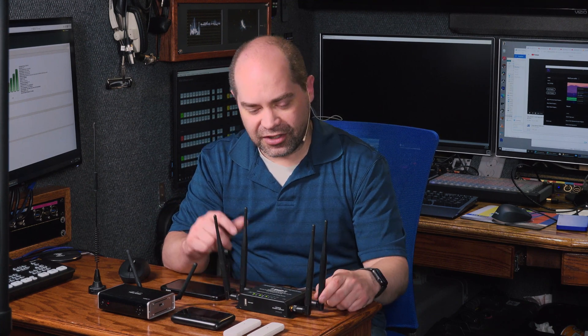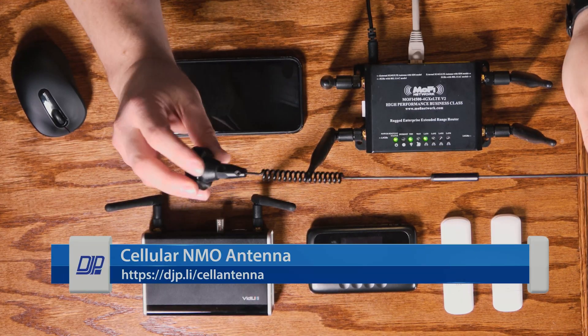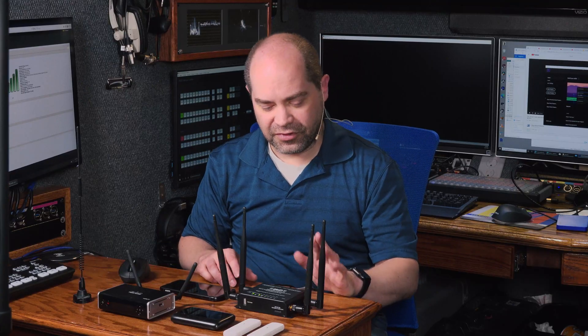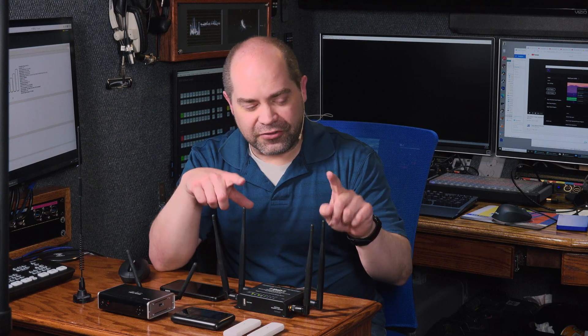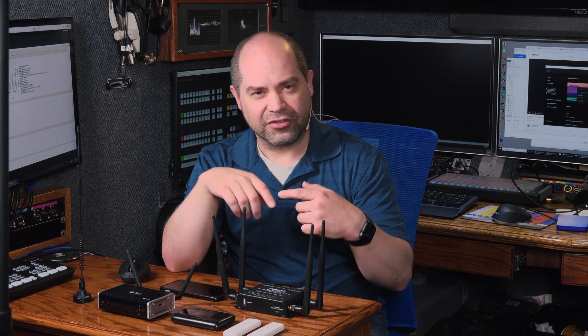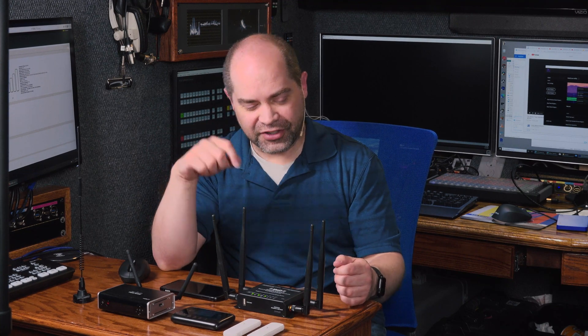Another great thing is that these antennas are removable. In my trailer, I have a few of these style antennas up on the roof to make sure I get really good quality coverage, and it absolutely works. Compared to the cell phone, this thing always gets way better coverage — if my cell phone has only one bar, this would have the equivalent of maybe three or four bars. It also supports antenna diversity with two antennas, so it can pick the signal from whichever antenna is stronger. If you're familiar with radio signals, there's something called multipath where one signal cancels out a reflected signal, but with diversity it's able to overcome that — if one antenna is being canceled out, the other one saves you.